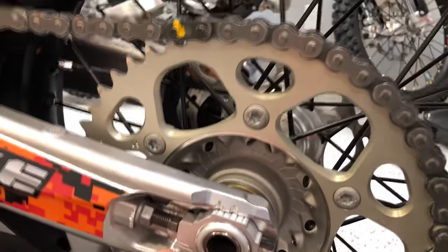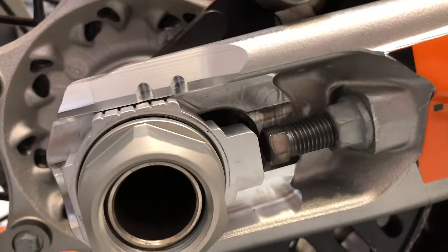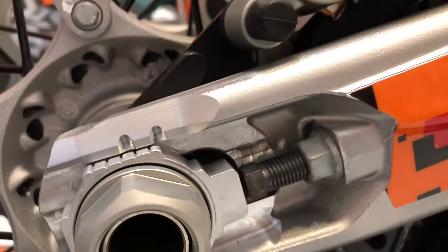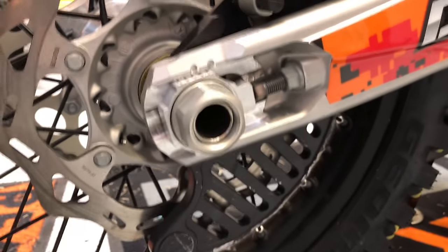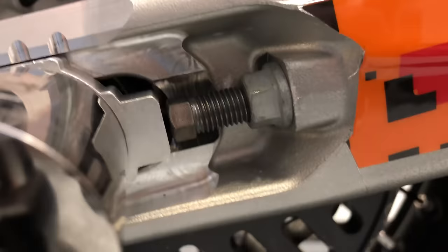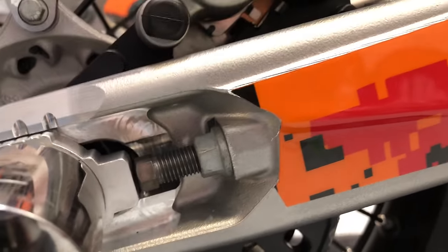I'm back here on the wheel. I had just been adjusting my chain tension using my adjustment blocks. I wanted to show you guys a quick tip on how you can tighten up your wheel and keep your adjustment block — keep the tire against those blocks and keep it tight. Because every once in a while when you go to tighten up your axle, if you've got a little bit of a gap right there, which is easy to do, it can cause problems because your axle can pull forward, and it's just not a good situation to be in.